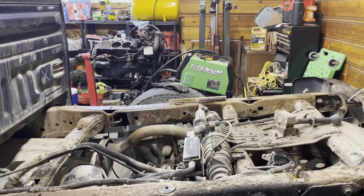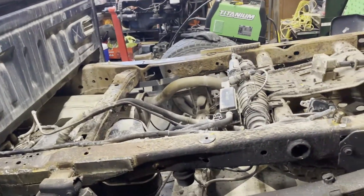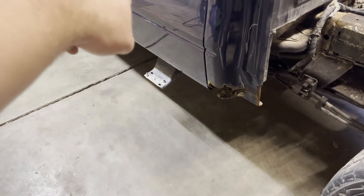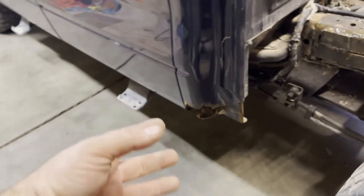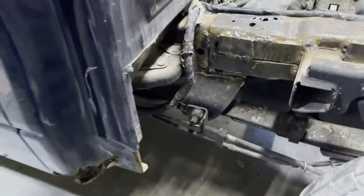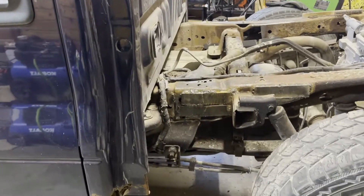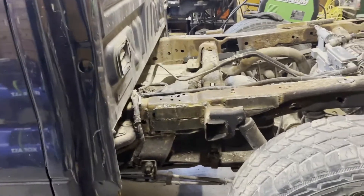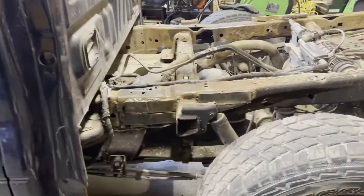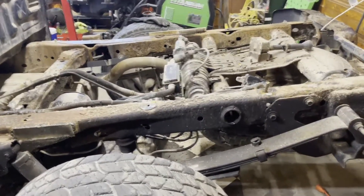This thing was so bad we couldn't get the bed off — it was pinched between the bumper and the back. I had to flip the truck around and bring it in nose first, jack it up along the frame. I had to get a two-by-four because the frame's rotted up there too, and I supported it underneath the leaf spring mount. I used jack stands to get a normal bed gap and then we were able to lift it off. Unless you've got a shop with a hoist, you're going to need some help — it's not a one-man job.